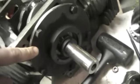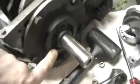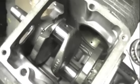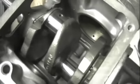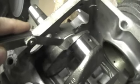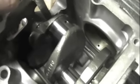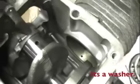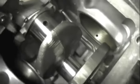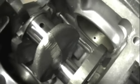Just snug them up right now. My crank is in here installed. We have the bearing crank cap installed. I've got to put the oil seals on either side. What we have to measure is the end play — the crank has to be allowed to go back and forth a little bit, and that measurement is between six thousandths and twelve thousandths of an inch. We just measure between the crank and this little end plate here. It's perfect — six.